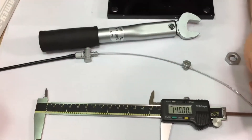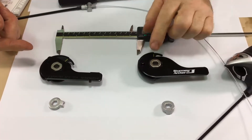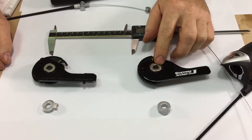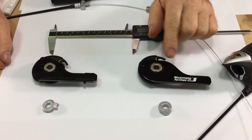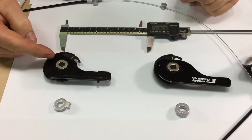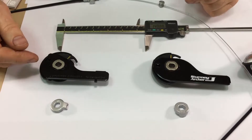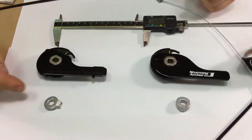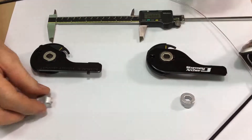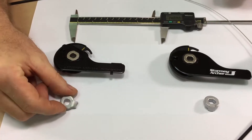Then select the appropriate fulcrum lever. This one is for vertical dropouts, track style dropouts, or reverse end dropouts. This one with the angle is for standard forward-facing dropouts. These are the corresponding non-turn washers you will use — this one is for vertical or track style dropouts, and this one is for traditional horizontal dropouts.